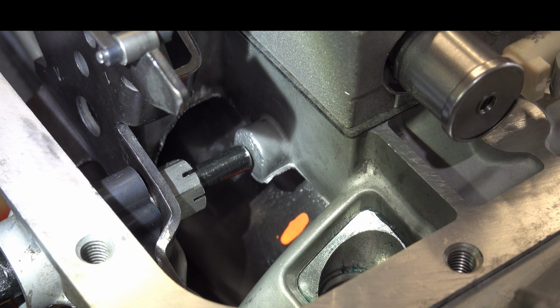And frankly, I would recommend that you replace your servo seals anyway, your O-rings and your scarf cut sealing rings. But let's just say for whatever reason you don't have that, you're trying to preserve this O-ring. What you want to do is take a pick just like this, get up in there, and get the pick so that you can get 2 fingers on each side, and then all you're going to do is pull out on the cover until it comes out.